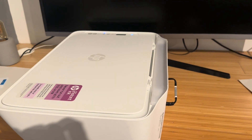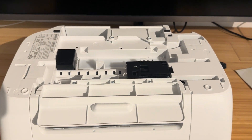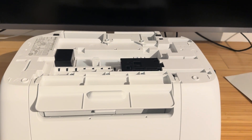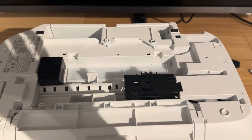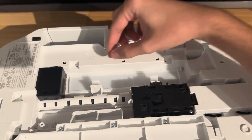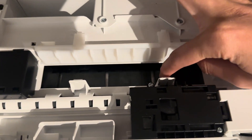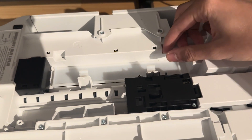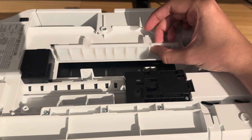Let's turn this printer around and try to clear this error. Remember, you need to unplug your printer before turning it upside down — you don't want to damage this inexpensive piece of hardware. As you can see, this is the clean out tray. It's held in by two clips, one on the left and one on the right. Flick it up and check if there's any paper stuck. Be very careful when pulling it out — you don't want it to rip and leave small shards of paper inside that you won't be able to remove.